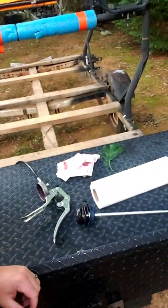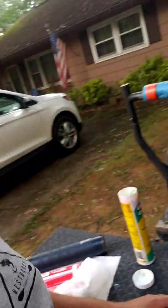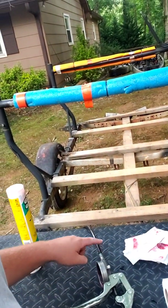It's pretty messy. I'm using just a standard grease gun, and I've got it torn apart right now, if you can see this. I had some standard automotive grease in it, and I'm taking it out and putting the new grease in. I've still got some of the automotive grease in the tube here, so I'm going to put the new grease in and do a couple pumps until the new grease starts coming out, so I'm not putting automotive grease into the tube.